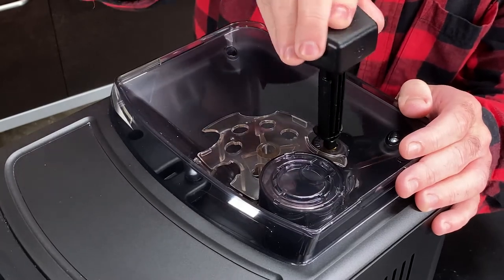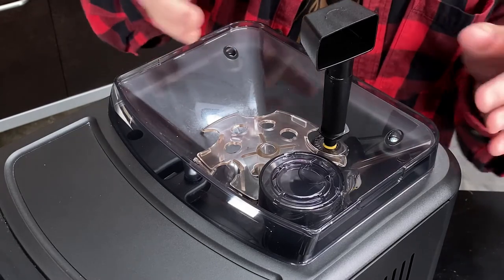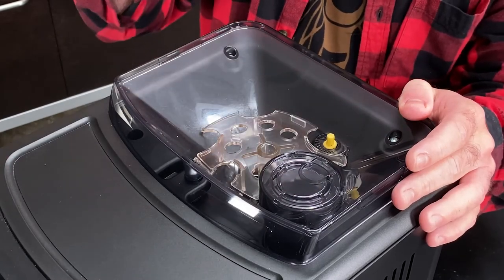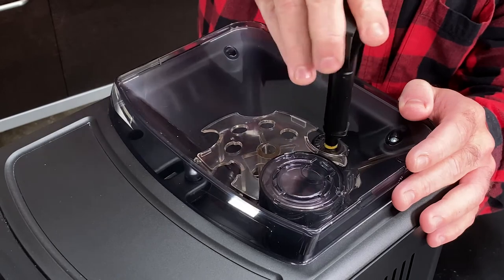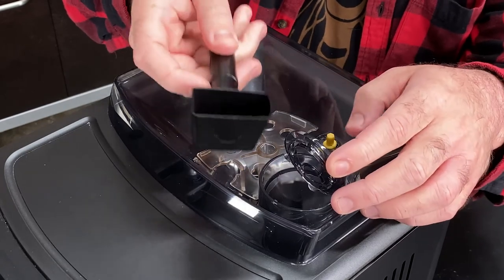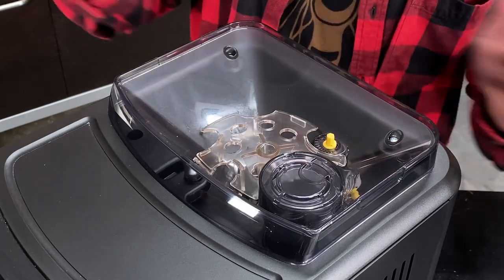We recommend that for the richest, most full-bodied shots, you really want to set this as fine as it can go. You may wonder if that's going to be too fine — don't worry about it. The machine has something called the Gaggia Adapting System that adjusts for your grind setting and your bean, so your doses will be accurate. But you'll be getting much more rich, full-bodied extractions with that very fine setting. You can always come back to the grinder afterwards if you want and make it a little more coarse. While we're up here, we can also see the bypass doser — you fill up your scoop with coffee, dump it in, and you can brew shots using pre-ground instead of the coffee in the grinder. Once you've got your grind set to where you want it to be, add your beans, and then we can start to brew.